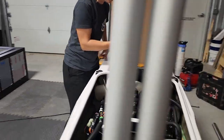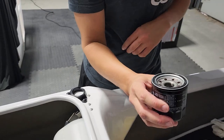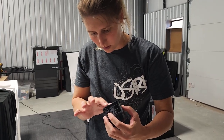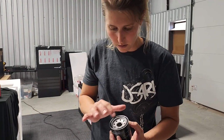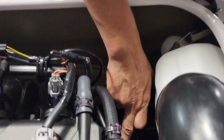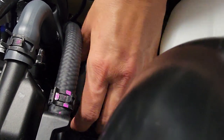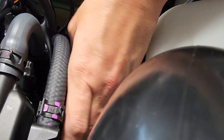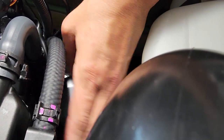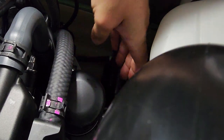Go ahead and get the new oil filter out. The OEM filter has a seal — this one actually comes with grease already on it, but if yours doesn't, make sure to cover it with oil. Make sure the mating surface is nice and clean with no debris, then put this on snug. It does not need to be gorilla tight — it's just an oil filter. Nice and snug is all you need. Maybe next time you won't have to use an oil filter wrench.